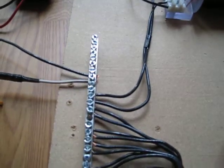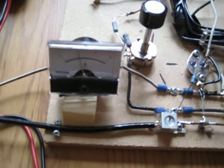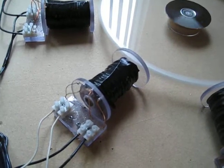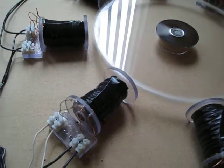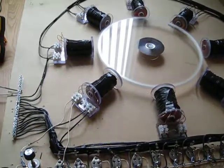I had to put the amp meter back in there from all the other electrical problems. It blew that five amp meter so I just got a three on there now. I haven't played with the position on the trigger run coil — it's dead center like all the other ones. So RPMs aren't up as high as they usually are, but at least we're back up and running. Alright guys, we'll catch you later. Have a good one.